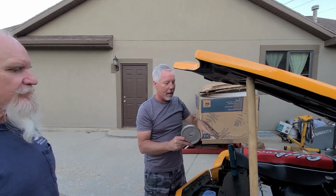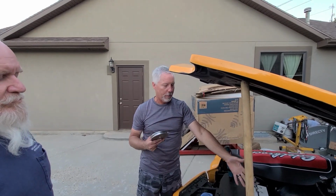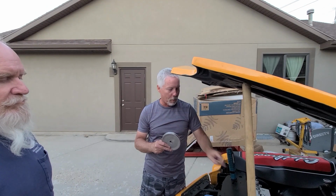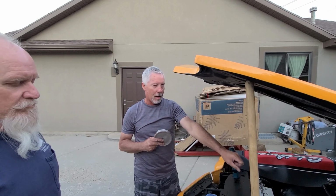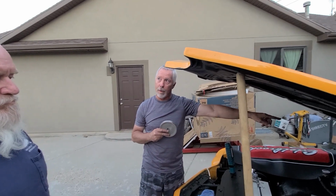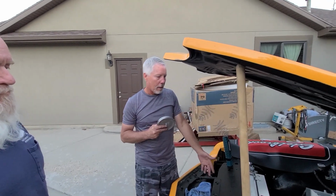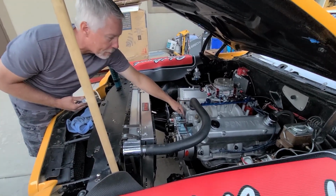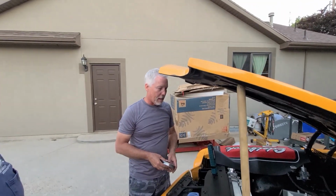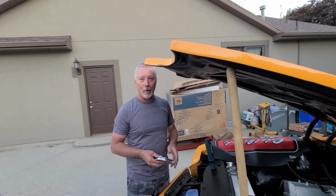We'll put this pulley back on, we'll test voltage at the alternator and back at the battery. And then we'll put the small pulley back on because I'm going to leave that one on regardless of the answer. But I'd like to see if there's a difference between this pulley and that pulley, voltage here and back there. I want to see what kind of voltage drop we're getting, which is 14.5 here and 13.3 or 4 back there. So we're losing 1 volt. I'm okay with that because I think we figured we got a 10 gauge wire here. So I think we bumped that up to an 8. That might help us out a little bit, but 13.5 volts is a lot better than the 0 we were getting, so we made progress.